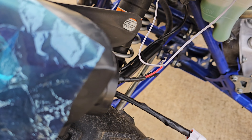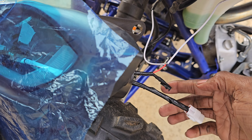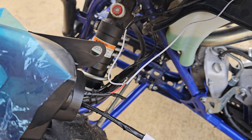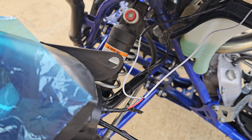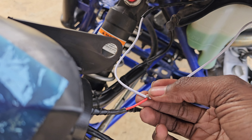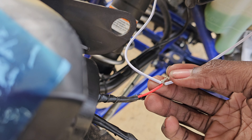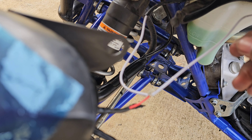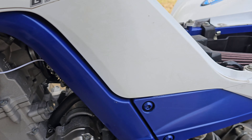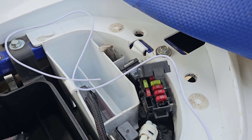If you want to use amber, on the left side it's gonna be a green wire, and on the opposite side it'll be a yellow wire. Once you pick whatever color you want, take another supplied white wire, connect it to the red daytime running light wire, and connect it to the white wire running from the other headlight. Then take this wire and run it through the frame, out to the back of your fuse box.